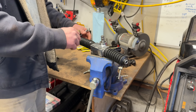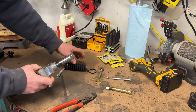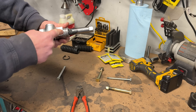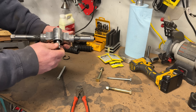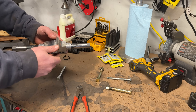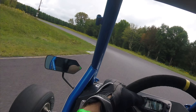I still got the highest grade possible of bolt because I'm trying to make this the most bulletproof steering rack for you guys. First things first, we've got to get rid of these boots — we'll put them back on but for right now we need access to the threaded part of the rack. For those who have never seen how a rack works, there's basically a gear in here with grease, and the ratio of that gear to the slots is what makes your steering easier, along with the diameter of your steering wheel — this is why I don't use power steering.